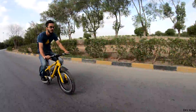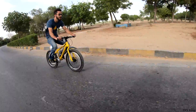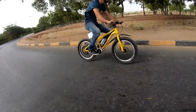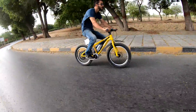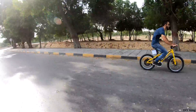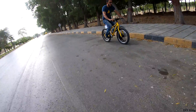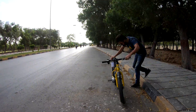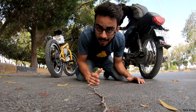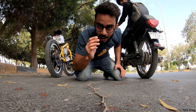This conversion ended up way better than we expected. The torque is amazing and the top speed was a bit over 60 km/h — yes, 60 km/h! With heavy throttle pull, the bike consumes nearly 30Wh per kilometer, which is fine because with the current battery capacity we can easily get over 20 kilometers of range on a single charge, or even more at moderate speeds. Now, just for comparison, we are going to race our electric bike against our conventional bike — have a look!